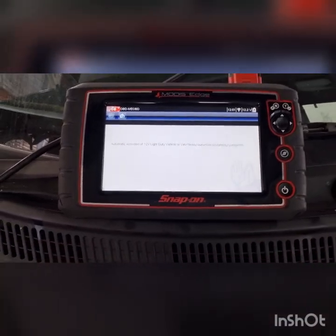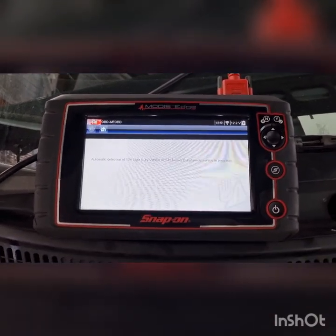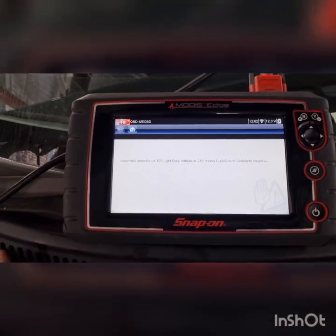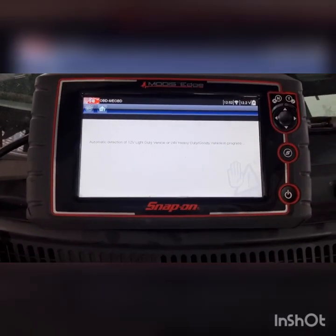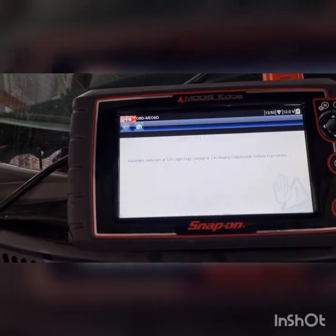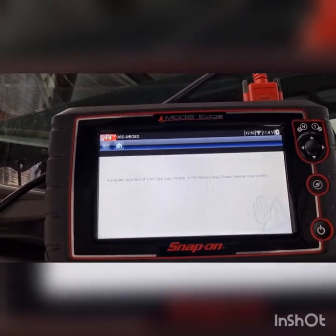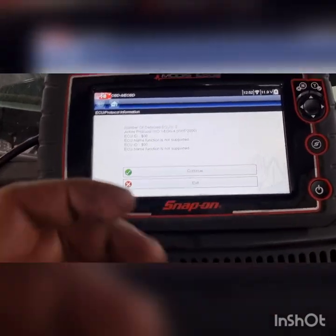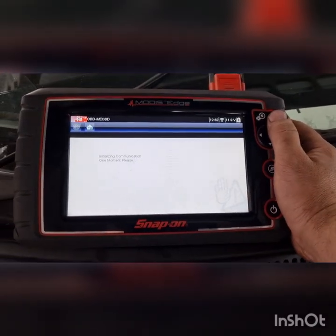Just thinking back about the fuel trim issue relating to the cat issue, that's not going to have any effect, because the fuel trims are doing the job to make the engine run at stoich anyway. Maybe if the fuel trims were super maxed out, but obviously we still had some short-term correction that was able to go on. So it's still probably running pretty close to 14.7, which would be the correct air-fuel ratio for the cat to do its thing. So this is just going to be a separate issue, but either way, still cool that we found this with no codes.